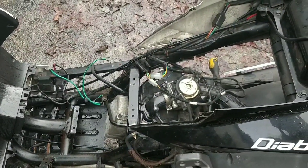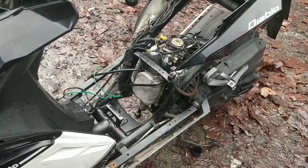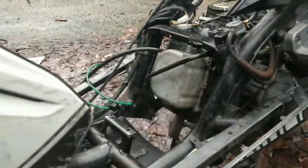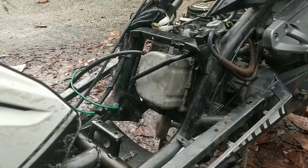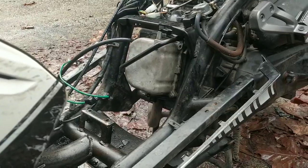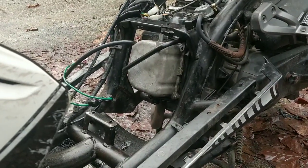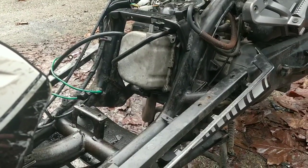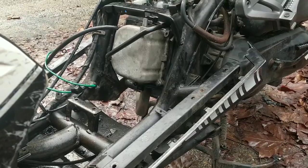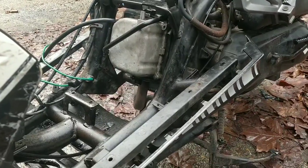I'm not going to show you the whole process because you know it - you've seen it. It shouldn't have worked yesterday, but it did, which means this engine has some life in it. You may have also seen me flush this engine six times - I ran it up to temperature, five to ten minutes each time, and flushed it six times. I did find bits of metal. I still think one or two small fragments wouldn't be a pain, but my plan is to run this bike for a week, start it every day, warm it up, top up the oil, then flush it a couple more times so it can all flow into the filter.